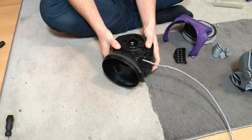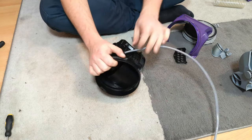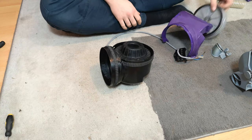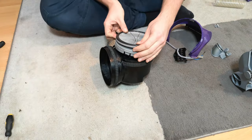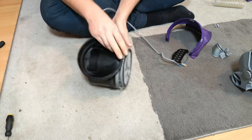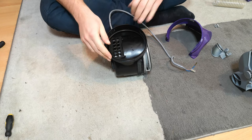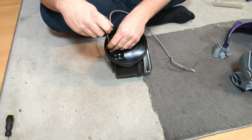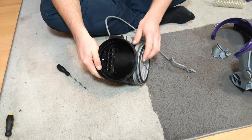If you've done it right, the motor will push in, your tabs will line up, your cable will pull out, and the grommet will sit perfectly. Take the housing — there's a little cutout at the top where the moulding stops — put that at the top and push it home. Then put the next small piece back on; do this early because if you drop its little screw into the machine after everything's bolted up, the whole thing will need to come out again.